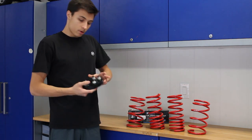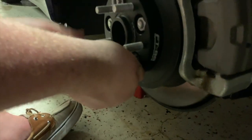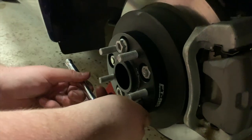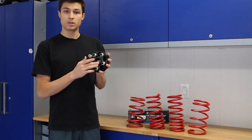You're going to want to torque your wheel spacers down to the car at 89 foot-pounds. This is the OEM setting, and then you're also going to torque the wheel to the spacer at 89 foot-pounds. These are pretty safe because they're made out of forged aluminum and there's a hub-centric ring.